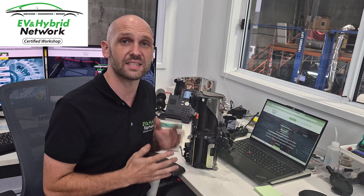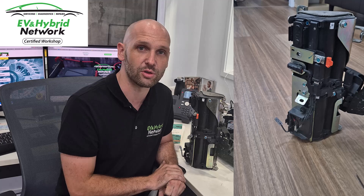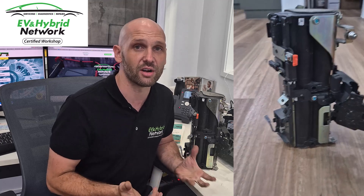This was out of a Mazda 6. A customer had an i-Eloop malfunction warning. We were able to utilise Mazda factory service information, which we have access to, to as efficiently as possible diagnose the fault and get to the fix the first time. The fault in this case is the capacitor, which is the heart of the i-Eloop system.